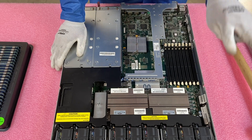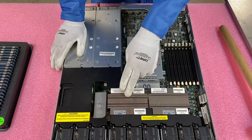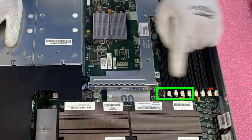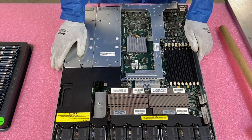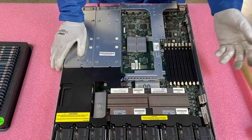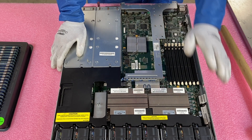As we discussed, there are two CPUs — CPU 1 and CPU 2. If you want to utilize all eight DIMM slots, you need to make sure you have both CPUs installed. CPU 1 controls the first four DIMM slots, and CPU 2 controls the next four. This machine is older — max it out. Put in 8x8 gigs. You can get 8 gigs for $100 these days, so it's a cheap and worthwhile upgrade to boost performance.